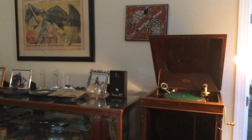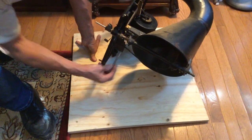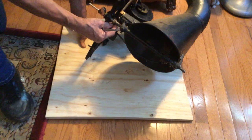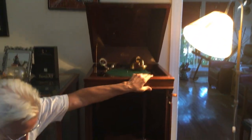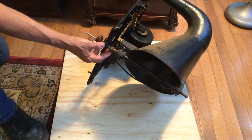This is an A100 for demos only. This piece right here is in your motor, and this spring right here moves on this casting. There's one screw here — you're going to unscrew it, pop it down, and set it so all this moves. You're going to put a little dab of oil where the spring hits the motorboard up there, and pull this up a little — just a touch, just a little bit. Tighten the screw and check the drag on this.